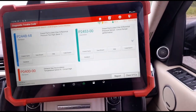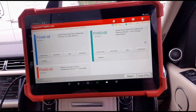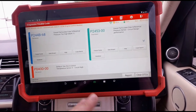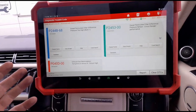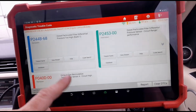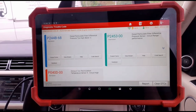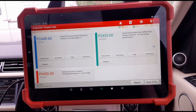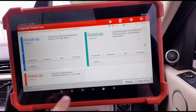This is a problem I see way too often. People call me and say they need a DPF clean. I ask what's wrong with the DPF, and they just say the garage said it's a DPF problem and it needs a clean - no further information, no proper diagnosis. What I always ask is: do you know how blocked it is, what are the millibar readings? No idea. People just read the code and say you've got a DPF problem, see you later.